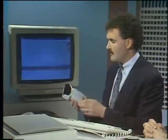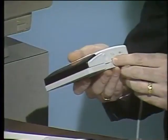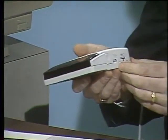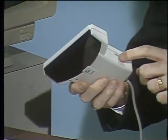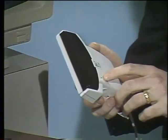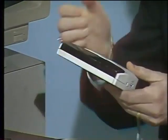With a hand scanner, you have to include some hardware functions right on the machine. You've got a selection of from 256 to 64 to 16 gray levels, and then black and white for line art if you're scanning text. You've got on-the-fly brightness and four selectable positions to choose different resolutions. There's a pilot light on top — it'll illuminate as you're scanning, and it goes from green to orange to red depending on how fast you scan. Typically, you want to keep it in the green. It gives you visual feedback so you don't go too fast and compress the image.